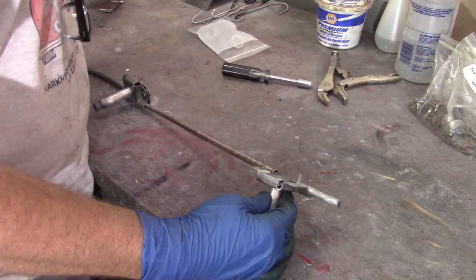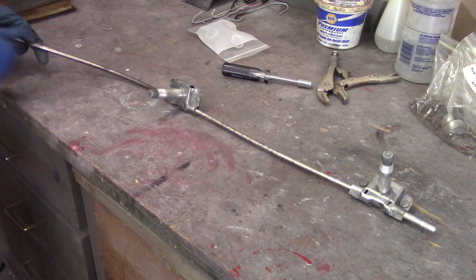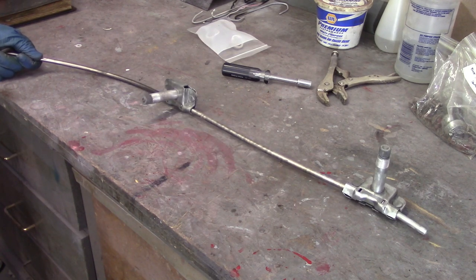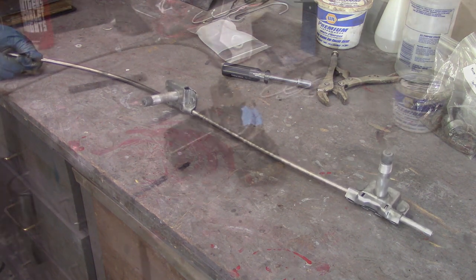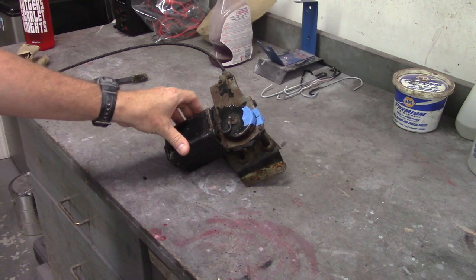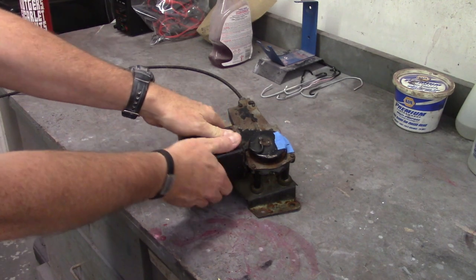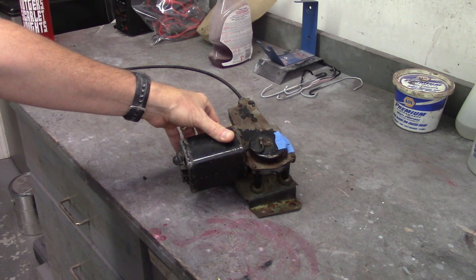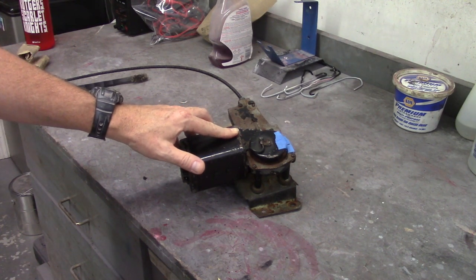Cap on, screw it down, and then that cable runs back and forth inside - you can see the windshield wipers would now be turning. This is the windshield wiper motor for the black car - this is the old style. The newer Spitfires have a round motor housing instead of square like this, because they changed the design from an electromagnetic motor to one using a permanent magnet.